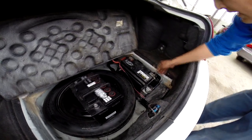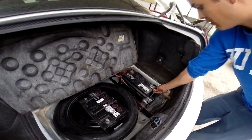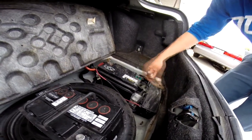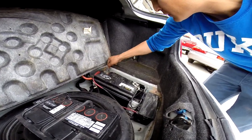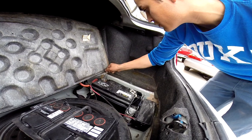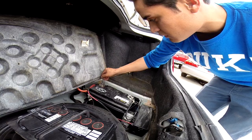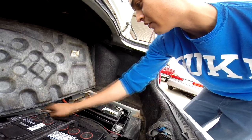So what we have to do is remove it using a 10mm tool right here, and disconnect the ground wire first. Sorry about the moving camera guys — I don't have the attachments to use the GoPro a little bit better. Very simple to do. There we go, we got it off.